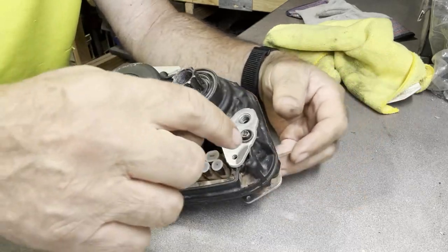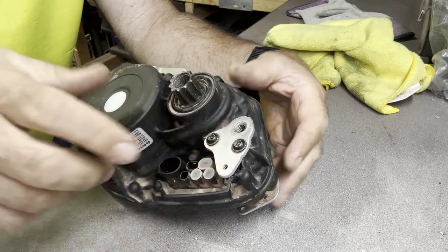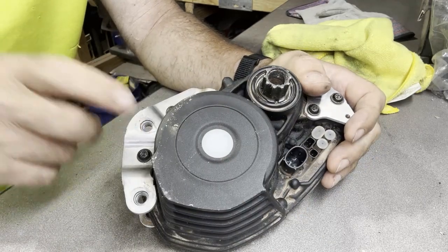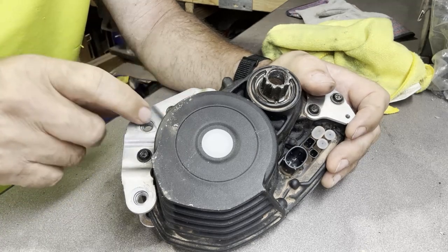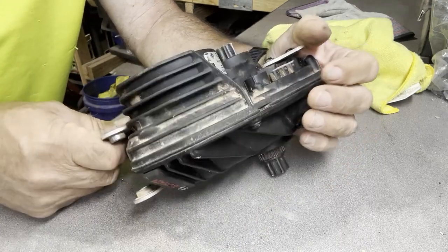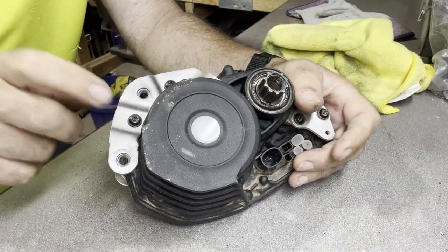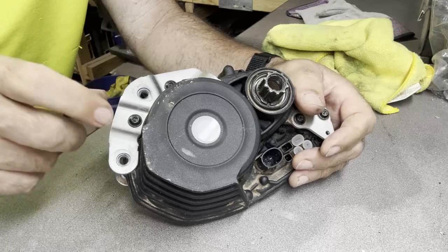So that's a heads up on the Bosch motors — these are all Bosch parts here, all these brackets. All these bike manufacturers use these brackets. You can buy these brackets if yours are bent too bad. Just doing a heads up — you might want to take a peek at your bike. It's pretty easy to get the motors out. Good luck, hope you don't have a broken mount, and have fun riding your EMTB!